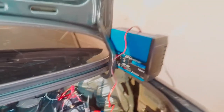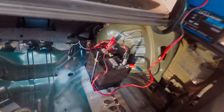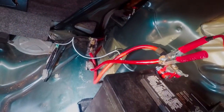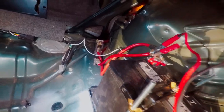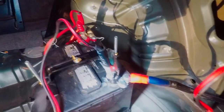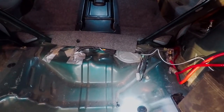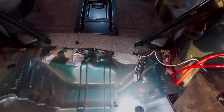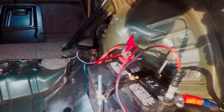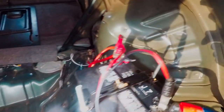It's the following day and I have the battery on charge here just because it's been disconnected for a while, but it honestly didn't lose much charge. I got our fuses hooked up with the covers on it. I might throw a couple of zip ties or some tape on it just to make sure the cover doesn't come off and short out. Battery connections are tight, positive all hooked up, and I decided to run the fuel pump wire - the constant power for my fuel pump relay - directly from the battery.